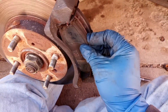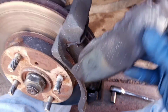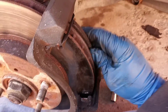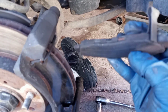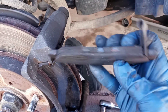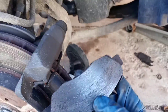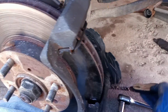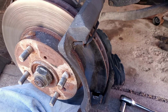I'll be a little more brief on the other side — I just wanted to show what's there as far as the pads go. That one's low but not bad. Now for the real thing — that backing just separated right off. It's paper again. Hadn't quite started grinding but it's paper — real close to being metal to metal. Change your brakes often, folks, get them inspected often. Don't do what I did.